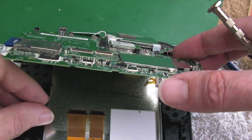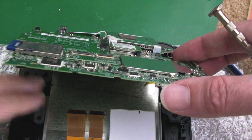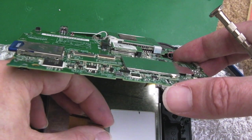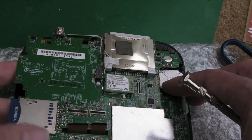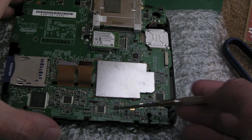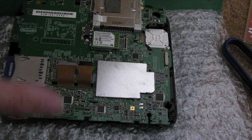Oh god. We need to stop knocking these buttons around because that's going to cause me no end of trouble. And we've got to somehow lift these up very gently and feed them through that hole, look. This is the tricky part of this, like that. And then we need to do a similar thing with all the ribbons down here. There are 3 ribbons or so that need to get aligned properly, and the one for the controller.